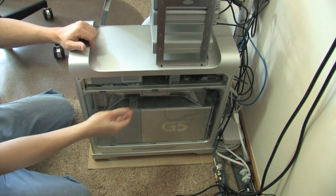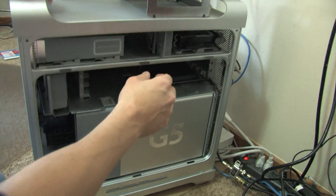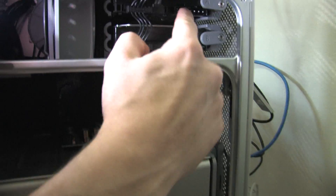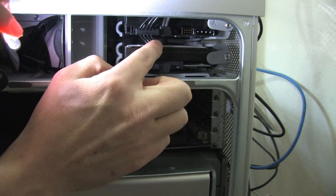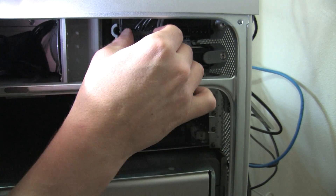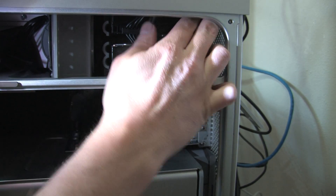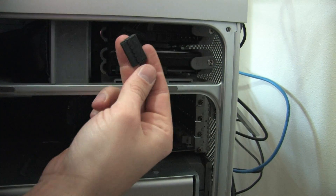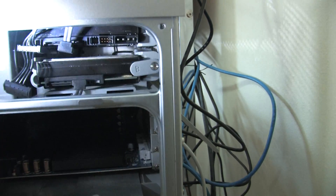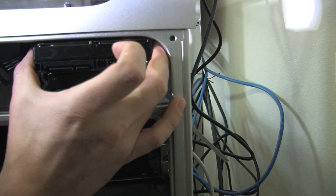I'm going to take out all this stuff again — my air deflector — and then both my hard drives are up here. You can see that there are two of them in here. There are two drives: you've got your master drive on top and your slave drive on the bottom. It's going to automatically read off the top drive, and that's my system drive. So I'm going to twist that thing up and pull out these — I'm going to latch this back down until I get these out. I'm just pulling out the serial cables here and then the power cable on top. Now I'm going to flip that lever up and the whole drive should slide out.